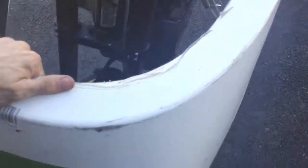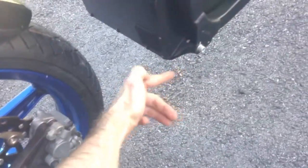What I'm looking at now is how I'm going to be mounting this, because traditionally — in that there's been one other person that has done this — you mount it by putting a bracket here. You actually weld to the frame, but I have my VIN number here. At the bottom, I'm going to be making a bracket that comes this way and then goes straight across as a bar, and it'll double as a footrest.